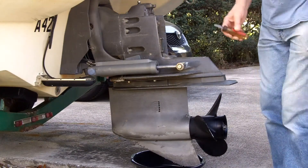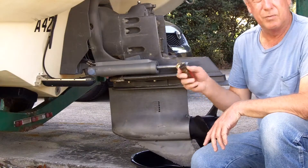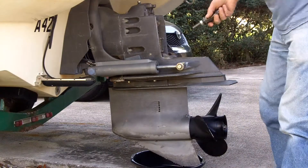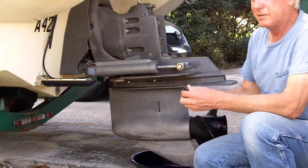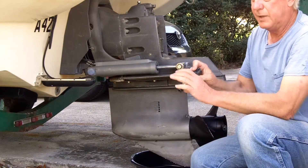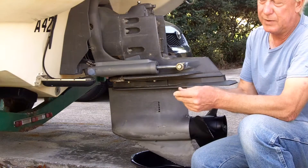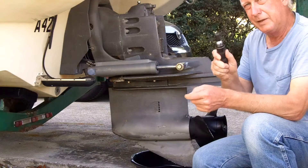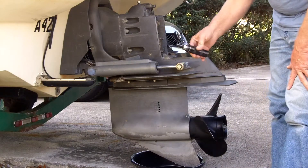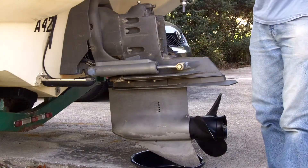I want to mention this screw underneath right down here — it's a flathead screw. If you're having trouble getting it off, don't strip it, as you can see in my pictures. There's a tool called an impact driver. It takes a regular 3/8 socket and you can put a straight blade on there. You put that in the slot and hit it with a hammer — it holds the driver in there as it turns the screw. You might need this. If you ever worked on old Hondas, this is what you needed to get the side cases off.